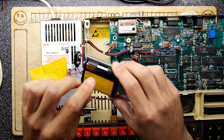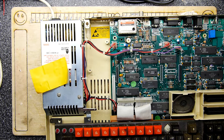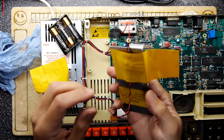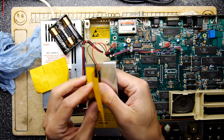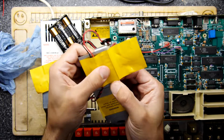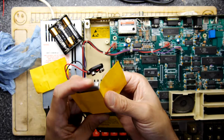Be very careful — let me do this over the bin — it's covered in corrosive battery effluence, which is going to be a big problem. Just wipe that off so we don't get it on your hands. There's also a metal plate here, and if you bend it over you'll see there's some componentry inside. That's basically why they don't want you to replace it — they don't want you messing that up. That componentry is quite simply a diode and a 120-ohm resistor to prevent the cells from charging up.